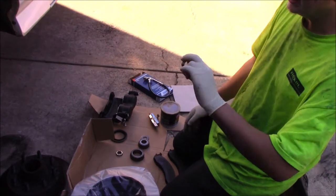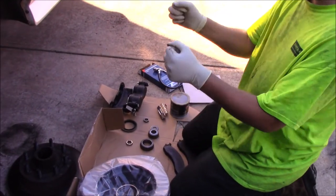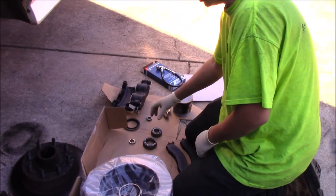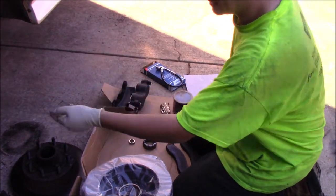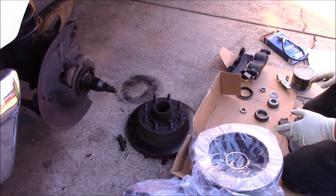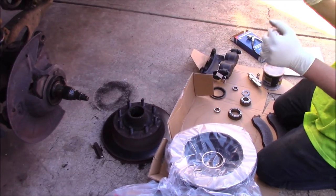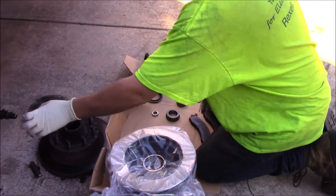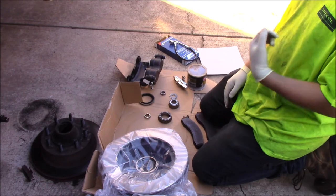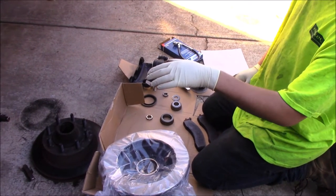Make sure you have a bleeder screw — always make sure you have a bleeder screw. New clips are always great. Whenever we go back together, whenever you pull the dust cap off, there will be a cotter pin going up over this piece, looped around it. Bend that cotter pin down and pull it out. This just slides off. Then there's a nut that's no more than pretty much finger tight.